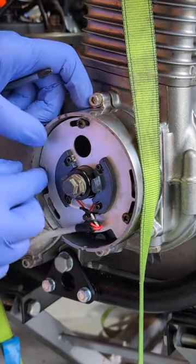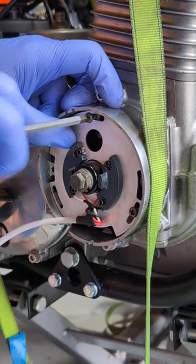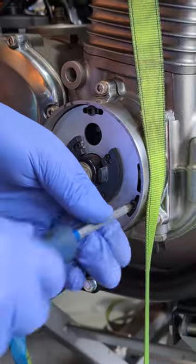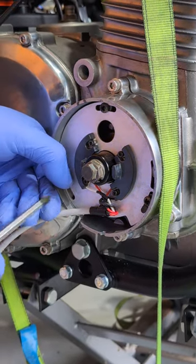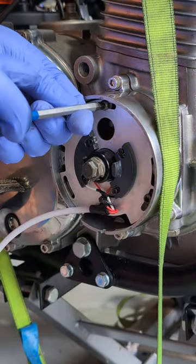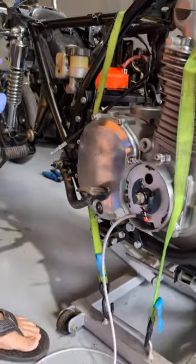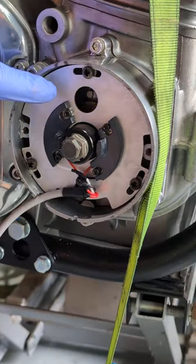So you just want to get that nipped up and give it a little adjustment. You just want the screws more or less centred — probably more for aesthetic purposes than anything else. We're just doing this finger tight for display purposes. Backing plate is installed. The screws were giving me a little bit of a hard time — they're just old screws. You can see the backing plate is fixed; these have adjustment and an Allen key is supplied, so you can move these if you need alignment up or down.